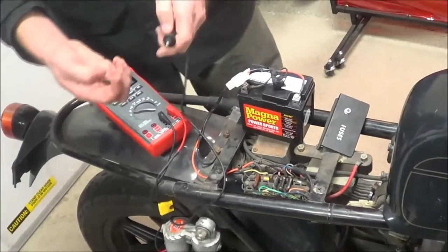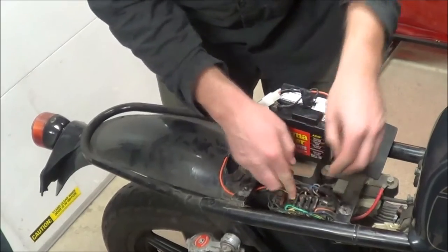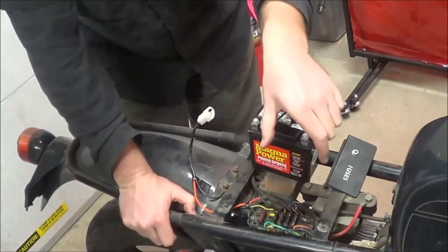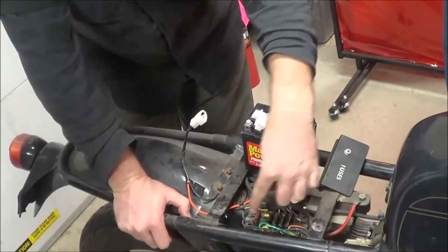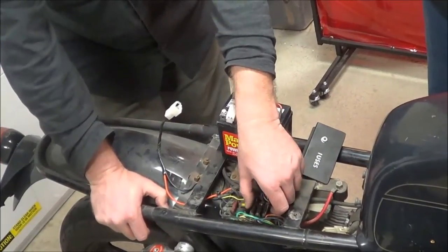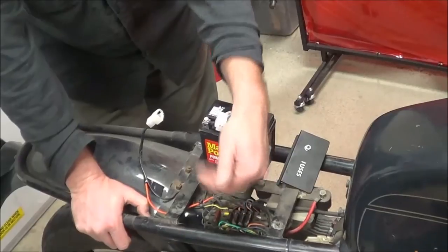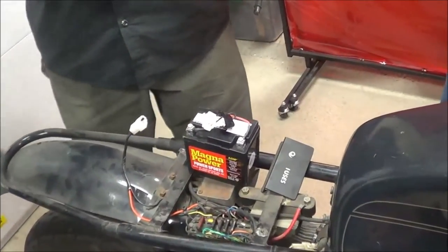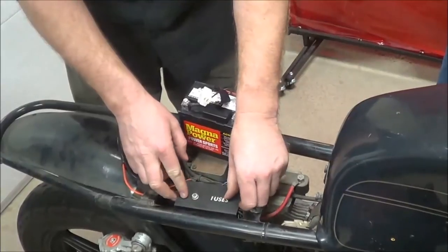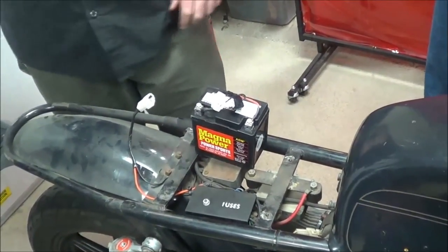That's a really quick way to make a couple of tests for ground verification. What do you think we're going to do to fix this? Go through and check our connections. What I have to do is take this fuse block out, and literally just try to clean these connections first. A lot of times they were so dirty on the top side that I got up to a half a volt to a volt drop just by cleaning the top side. But if they were that dirty on top, what do you bet on the bottom? Probably pretty bad. So that resistance increases heat and reduces the voltage — like my ignition system right now, is it getting the full potential? No, not at all. The lights aren't getting full potential either. That's a real good video to start off on how to do a ground verification and some quick checks at the fuses.